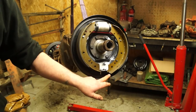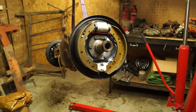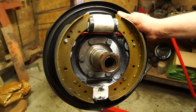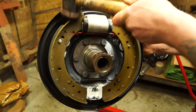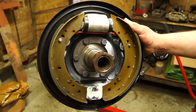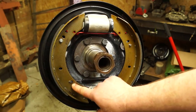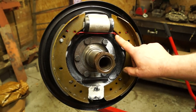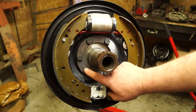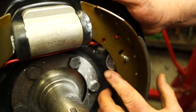I do have a problem here because this axle is a free-floating type. On a Land Rover it's not a problem. I had to make up a tool — a grip with a long bar on it — and my son Eugene held the axle still while I pushed it into place. On the Land Rover everything is fixed and solid. The shoes are tappable — you can move them to square them up using a copper or hide-headed hammer. The retainer spring and return spring positions are important.